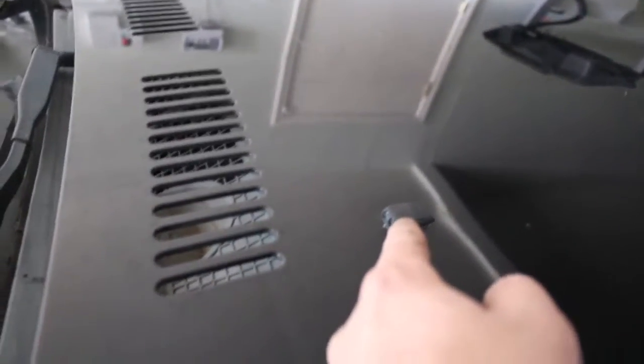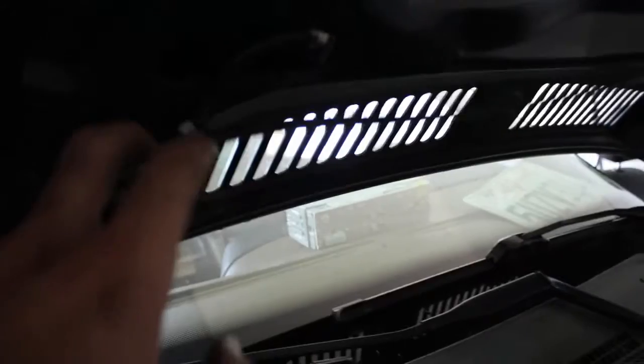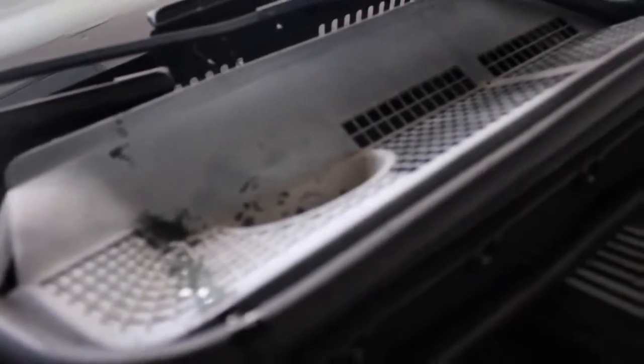I found out a few more things before I wrap up this video. I didn't know where the windshield wipers were — it was leaking and spraying randomly underneath the car. The wires underneath were supposed to connect to the hood nozzles. I didn't know because I've never owned a '96 — the water comes out of the hood, basically. These cables were not connected — I just connected them. So you can literally unplug it and plug it right back in. If it ever falls out or you think it's not spraying, you can always unplug and replace these heads. On an E36, it's a really easy fix.